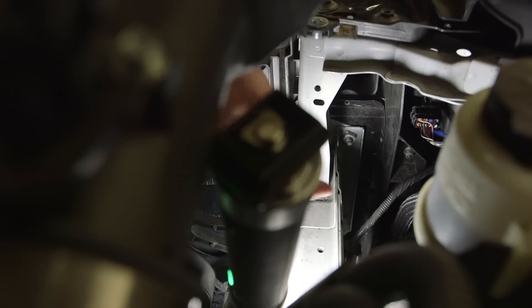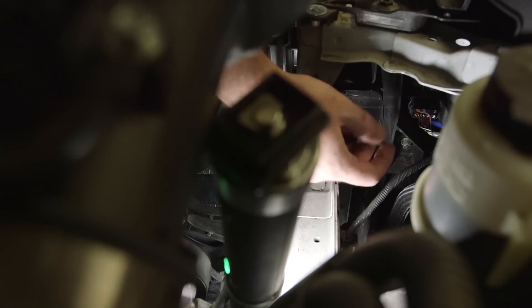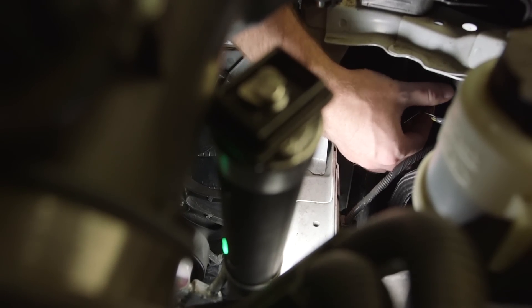This is a hard shot to get on camera, but all I'm doing is reaching down. This is the headlight connector we've got to unplug — this is the back of the air box. There's plenty of room down here, just hard to show on camera. We're going to be unplugging this headlight connector. There's a clip on the bottom side that is pretty tight, so I'm going to use a small tool to depress just that tab. If you get it on there just right, you just have to press up. It might be helpful to unclip it with one hand and use your other hand to pull it back. Just feel around, get a little tool and you'll be able to get it unplugged.